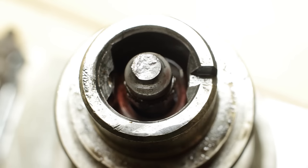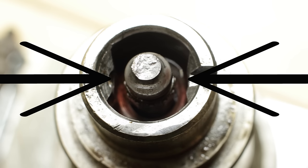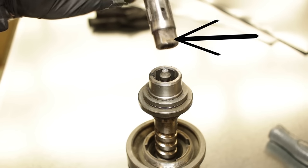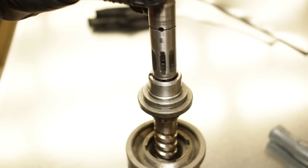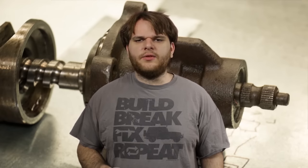This is the top of the ball lead screw. You can see the metering rod broken off here. There are flat spots here and here, and there are similar flat spots on the input shaft. The input shaft goes into the ball lead screw. There is enough play to allow the input shaft to spin a little, but not enough to permanently deform the metering rod. These stops would be used if your power steering system wasn't working or you maxed out your power steering system.